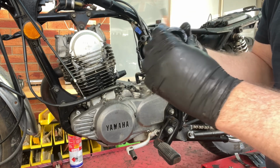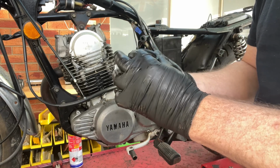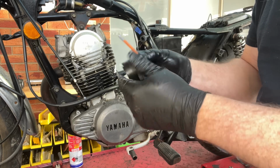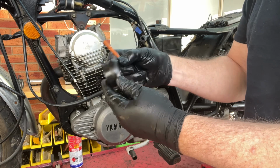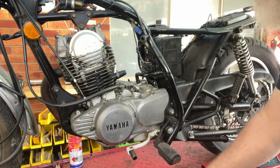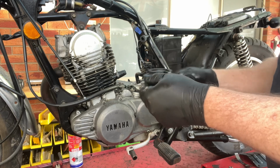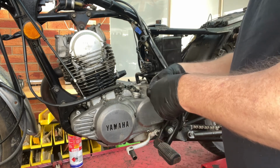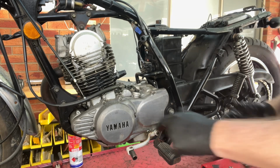I like to replace these as much as I can. We'll see, because it's only a single. It's really easy to diagnose if it was, and I'm able to seal that pretty well and seal it around the carburetor, so it's not too much of a drama. The multis, where you take 7 hours to get everything off just before you even get to the carburetor, is where the issues can be.